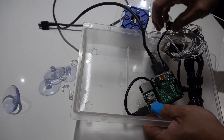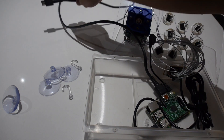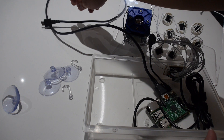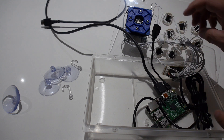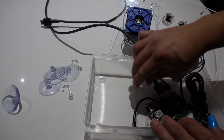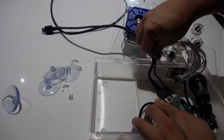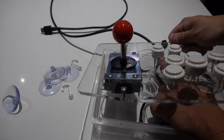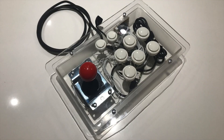You want to make sure that the wires will fit through that little groove so that you can close it properly. For the HDMI cable, you can use a very short and thin one, then use an extension cable if it's not long enough. The OTG cable is powered with a USB male-A to A connector. All that's left is to make sure the wires are nicely tidied up and don't get in the way of anything else. Push the HDMI cable and OTG cable to the side, then put on the top cover and screw on the four bolts.